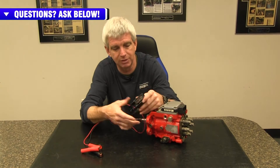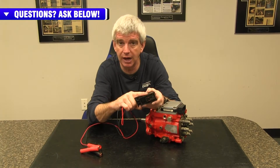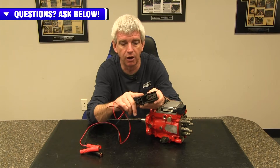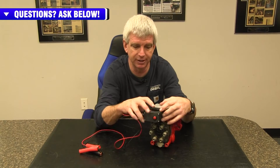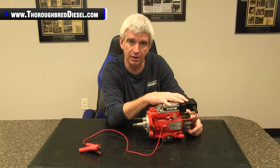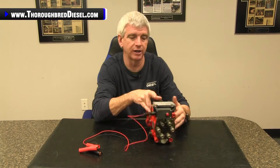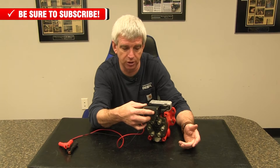You can apply this breakout box and the truck will start and run again, independent of the ECM. So if you've got an ECM failure, or maybe your crank position sensor is a problem for no start, this would isolate that. This has all of the features on our wishlist. We use the genuine OEM style PSG harness and clip at the PSG — this works just like your stock harness, slides right on the PSG, clamps and locks on. If you want to shut the truck off, you just hit the red button right here.